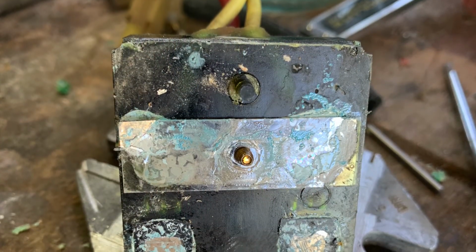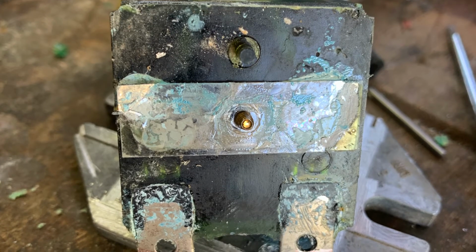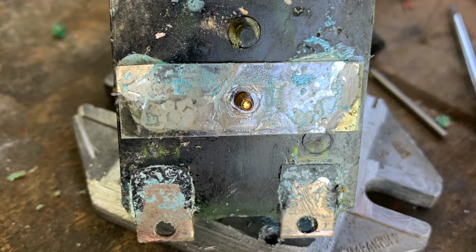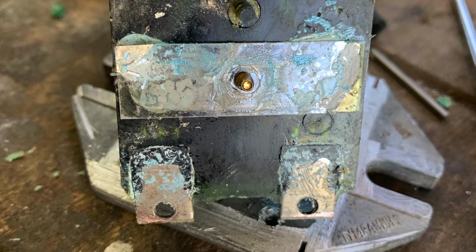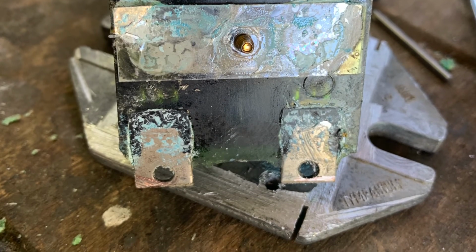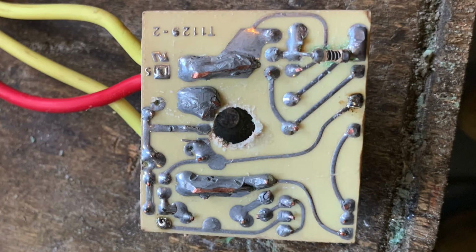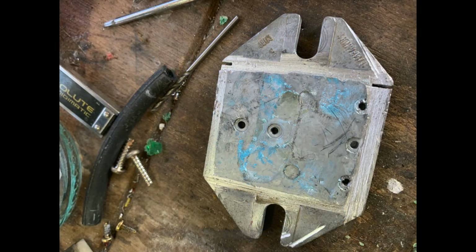There are 3 screws holding the devices in. As you can see, they're all T10s. The 2 holding the big transistor-like devices are at the tops. The center device has a hole through the circuit board. You need to excavate that to get at it.